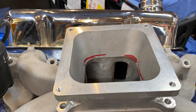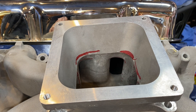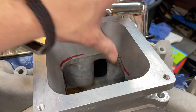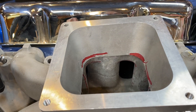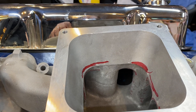Here's what it looks like with the adapter for the 1050 on a 4150 manifold. Look at that — there's a ledge here, and that ledge is like a quarter inch. Same here. I know I can blend that thing to bring it all in there. It's a lot of work, but I've said, what the heck — I've got to at least try it. Never did any porting, so let's see what I can do. I also found another adapter.